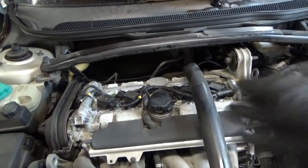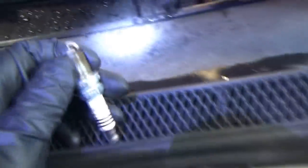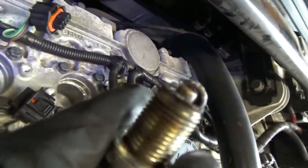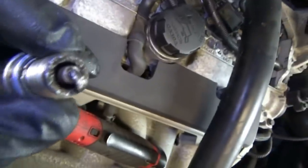Let's pull the spark plug out and see what happens. So we took the coils out — spark plug number two looks beautiful, no problems. Spark plug number one is smashed mechanically, like something hammered it. You can see bam bam bam bam, just completely hammered.